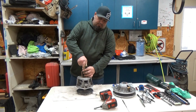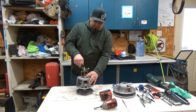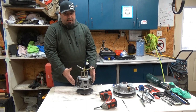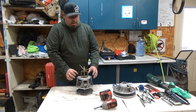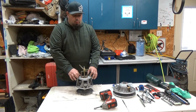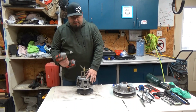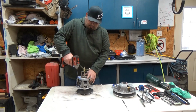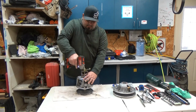Washer. Okay. You're not tightening this down to kill it. All you're doing is relieving the pressure because there is a spring here, and when we release these six bolts, it's going to want to come up. So, takes 3/8 socket. Just tap it. Don't hammer on it.